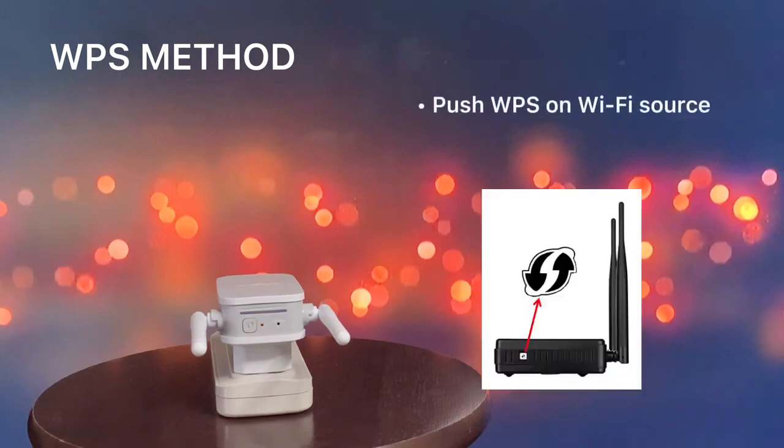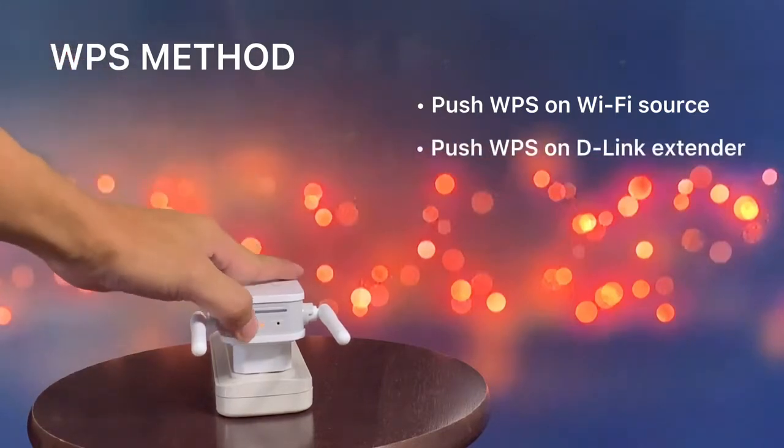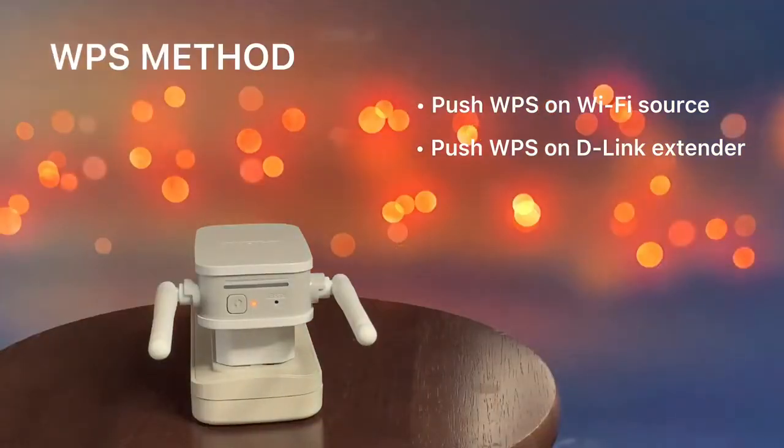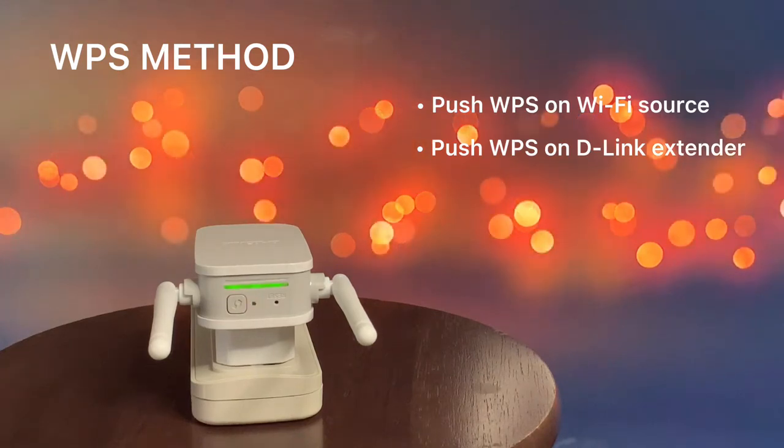Step 2. Push the WPS button on your source wireless router. Then push the WPS button on the D-Link extender. The status light will start flashing green. Wait for a few minutes for the process to finish. The status light will turn solid green when the extender unit has connected successfully.